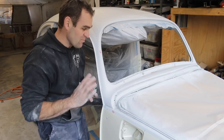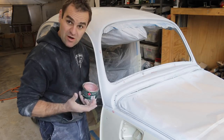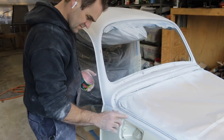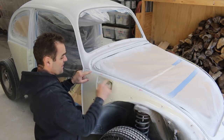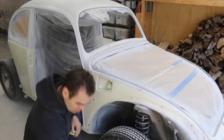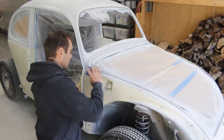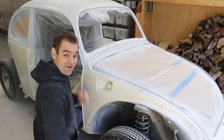This is not going to be a show quality paint job by any means, but I want it nice because it's me. All of the little spot putty bits have set up now, so I'm going to go back with a solid foam block and block them all out, and then we can get her back in the booth and start getting ready to paint.